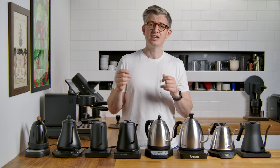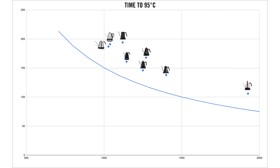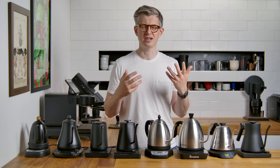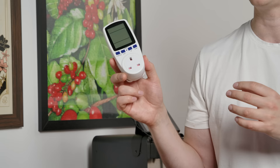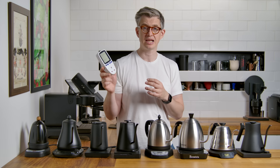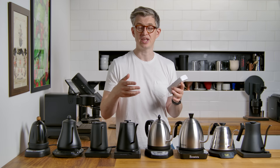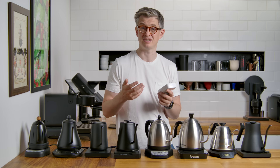As you look at the chart, you'll see that kettles further directly above that line were slower for the power that they had. There were a couple of standouts. During all of this, they were plugged into a cheap socket meter that let me see their actual wattage draw. The voltage in the studio is higher than typically rated — we're at about 245 volts — which is why there was a big bump in wattage from the kettles versus what they listed as pulling. In most cases they were pulling more than 10% above listed wattage.